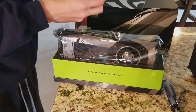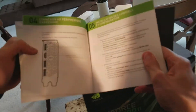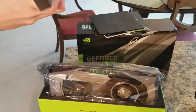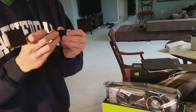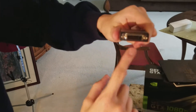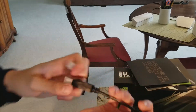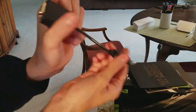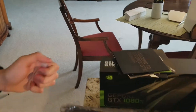This is the manual — quick start guide showing how you install it and what the ports are. These are the ports where you plug in your monitor. Oh, it's DVI. So this is the DVI adapter. If you have a monitor that connects to this kind of port, the graphics card itself actually doesn't have this port — it only has these video ports. So this is an adapter so you can plug it into the graphics card and then plug it into your monitor. Pretty cool.